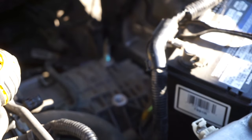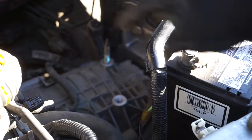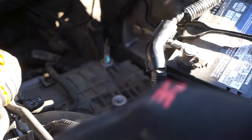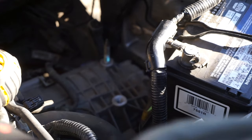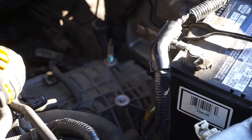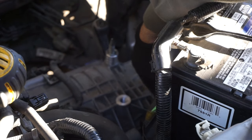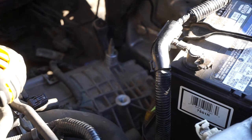Here's the motor mount. I really can't stress this enough: when you do this, make sure you're supporting your motor with your jack. I put some wood under there so it wouldn't mess up the oil pan, and I put two jacks under there to have it leveled. I'm supporting the tranny and the oil pan on the left side. Now that we've got these out, the spacer goes in here and then another one on the other bolt, then put this back.